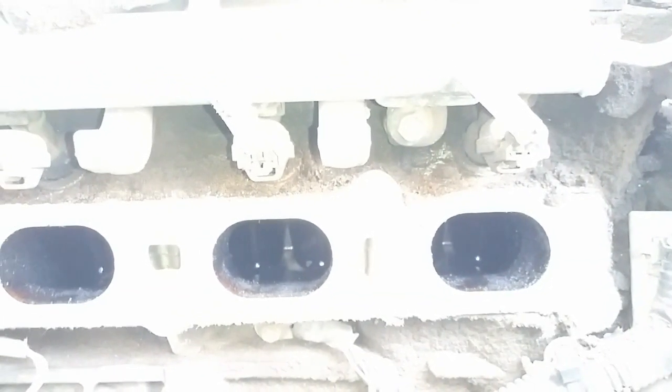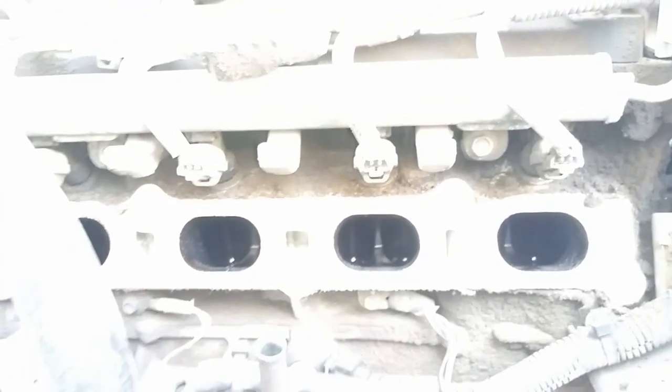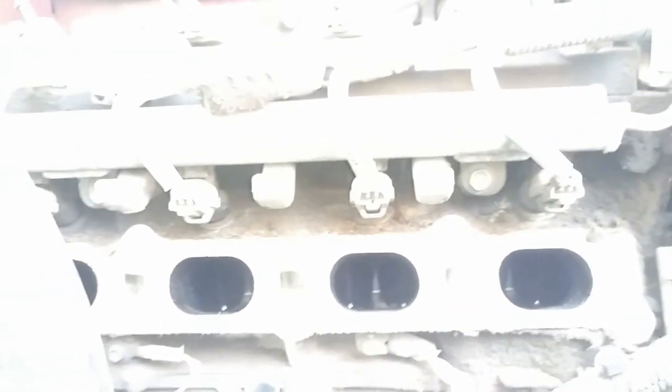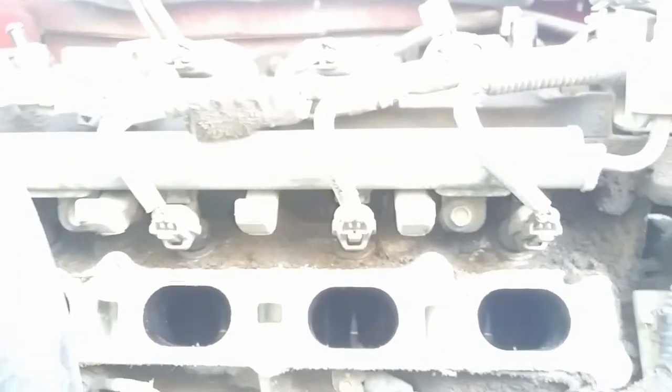There's my injectors. Make sure those are all plugged in good. Gently. Huh. Now would be a good time to do all kinds of work to this thing. Put some high flow injectors in there maybe. Or some new injectors. Or just take that thing out and have it cleaned professionally. That whole fuel rail. Unbolt it right there. 2 bolts. That looks like a knock sensor right there.